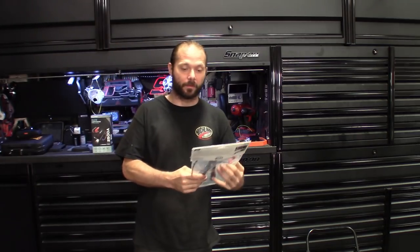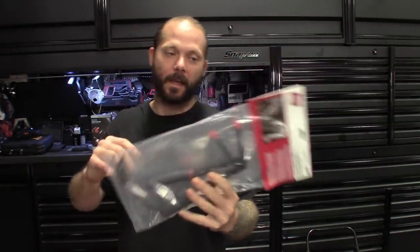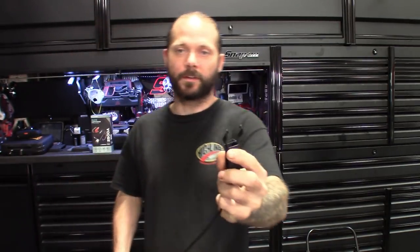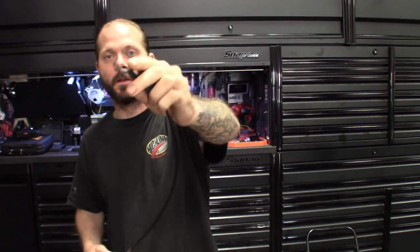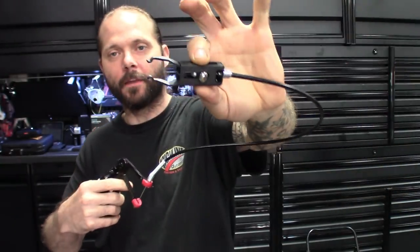I really dig part number 35070. It's a remote hose clamp — like a normal remote hose clamp pliers — but instead this one gets those quick connects off. It has little fingers at the end of it. You got to figure you get those quick connects on the top of the gas tanks or those evap lines and all that stuff where maybe you can't get to the bottom of it, or the pliers are too big. This one being a remote setup, you can get it to ratchet and hold it, open up real wide, get it around your quick connect.